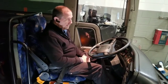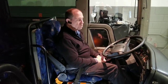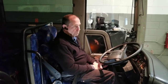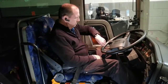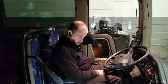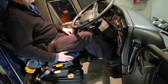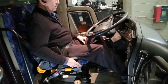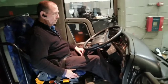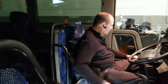After this minute is up, the next step is I'm going to pump down my brakes. Before I get to 60 PSI I should get either a light, a buzzer, or a bell — I don't need all of them, as long as I have one. Then continue to pump them down, and before 20 PSI my emergency brake should pop up. My first light came on at about 80 PSI, second light at about 75 PSI, and my emergency brake popped up a little before 20 PSI.